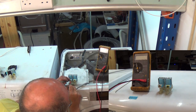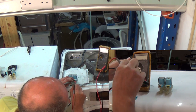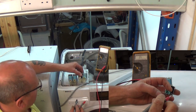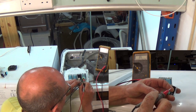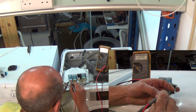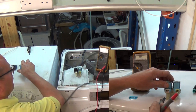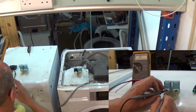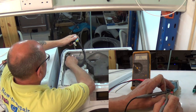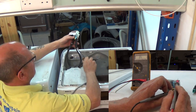It is worth taking a picture of the wiring when removing them from the valve, but normally the plugs will only go into each individual valve. Now the water valves are controlled with electronic solenoids. The solenoids should have a field when put onto continuity on your multimeter. The one on the right is faulty. This is a new valve and I'm just showing you we've got about a 1200 reading. Now we'll test the valve that we just took off. The one on the left has a field although it is quite low, but the one on the right is open circuit. This is the faulty valve, so we need to replace the water valve.